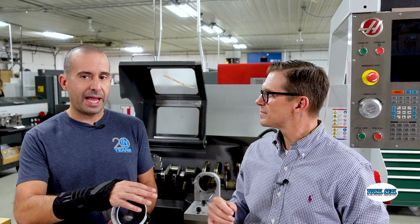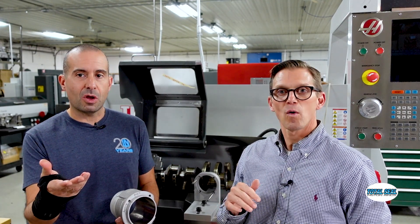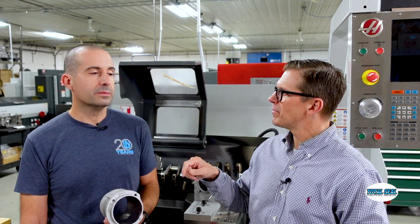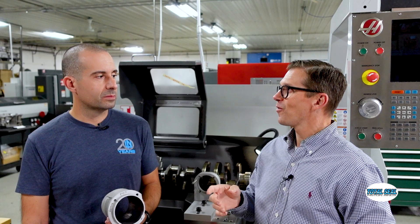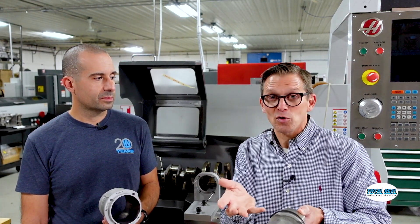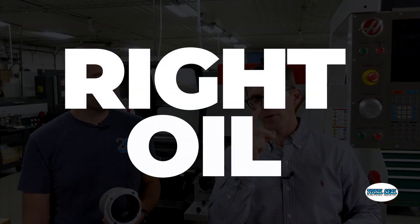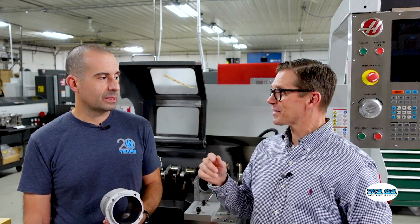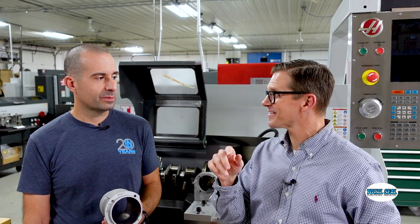At 120 cycles there was a little bit of streaking going on, which we expect from the rings. But by the time we got to 1,200 cycles, the streaking was all gone. Once you clean that cylinder out, all traces of anything you could visibly see were gone — you can still see some stuff with the microscope, but only at the very top where there's no lubrication, and at the very bottom where debris would puddle, because there's no filter in this application.